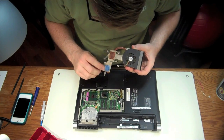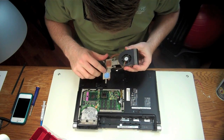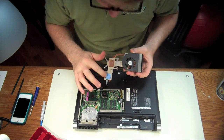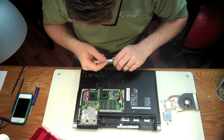See this little blue pad right here? This is the GPU cooling pad. You can leave that there as long as it's pretty well intact — this one seems okay. If it's not well intact, you need to pull that off and add thermal paste to the GPU. But in this case, we don't need to do that.